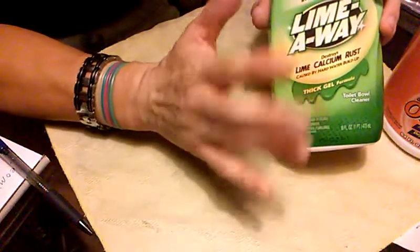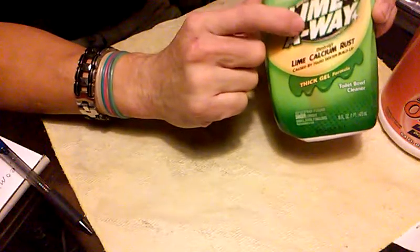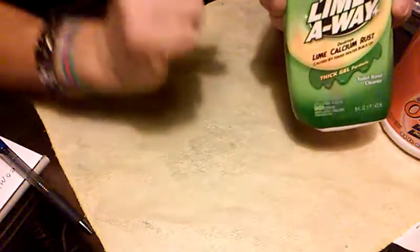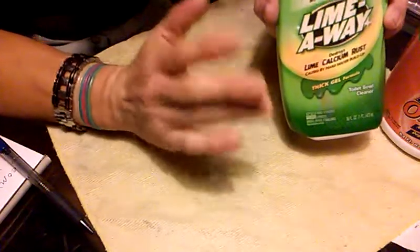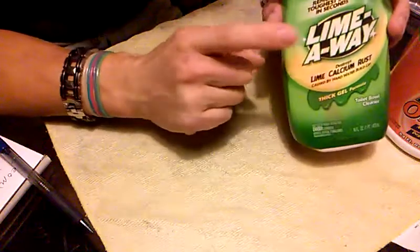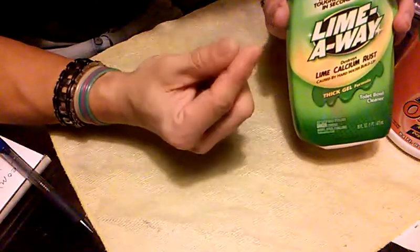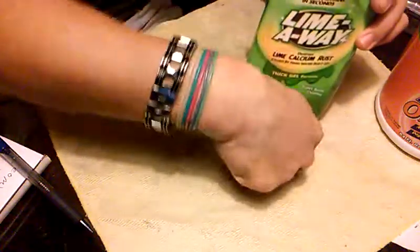Now, the way to do this without painting it is to strip it down to its bare metal and dip it in clear coat. You heard me say it right. Dip it in clear coat, and the clear coat that you use is the Rust-Oleum, $15. It is as thin as water. So when you dip it and when you pull it out, you're going to say, "Oh my God, is it even on there?"